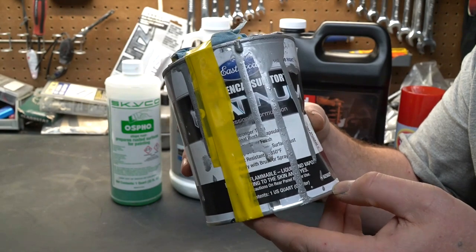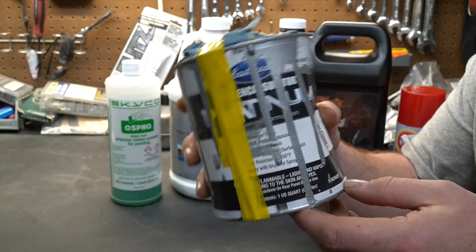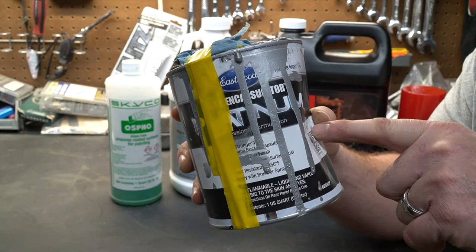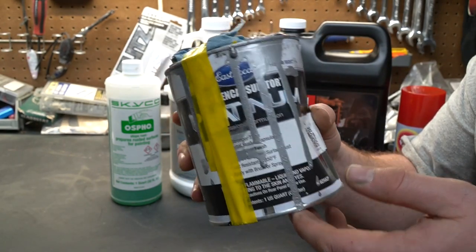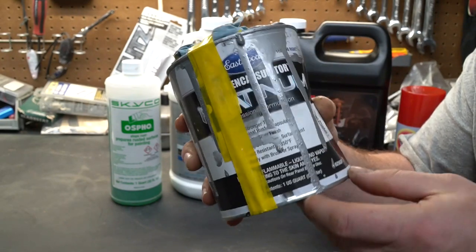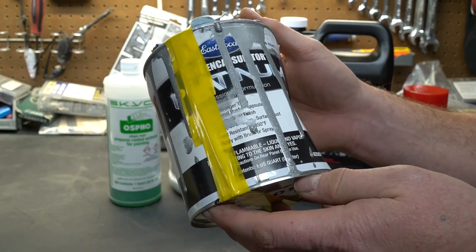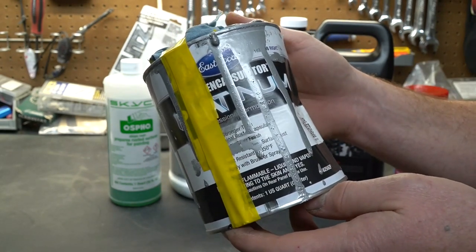The first product I want to talk about is a rust encapsulator. Many manufacturers make this type of product. This is made by Eastwood — it's their Platinum Encapsulator and I think it works extremely well. It's my go-to when I want an encapsulator; I actually think it works a little better than POR-15. The secret behind a really good encapsulator is moisture curing — moisture causes it to cure. When you paint over rust, if there's any moisture inside, it soaks that up to cure and then seals itself from the atmosphere. In theory, if the rust never gets wet again, it doesn't rust anymore. After it cures it dries into a very hard, sandable substance. You can paint over the top of it, but using it as a top coat is fine — it locks the rust in and stops it from rusting further.